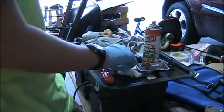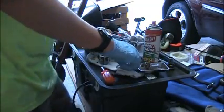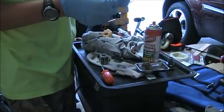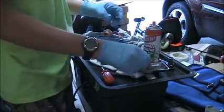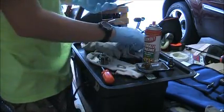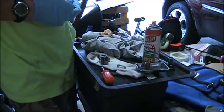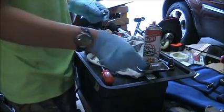So I'll go ahead and put them on and give the primer bulb plate a couple shots of carb cleaner. And since these are the old diaphragms, they're really hard. I usually don't like to get carburetor cleaner on the diaphragms and gaskets because it deteriorates them. So yeah, that's a very hard pump diaphragm.